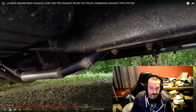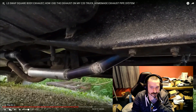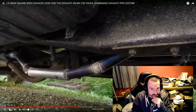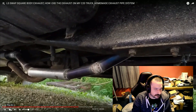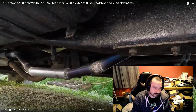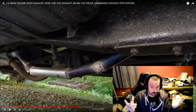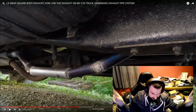I don't have a pipe bender at this location, and moving a rollback is not practical. When you don't have a pipe bender on hand, you are the pipe bender. Basically what we did is we cut a slice here, then we bent the pipe to get a gap, and then we just plated the gap. My plan is to get a pipe bender, redo this exhaust, undo this, and have everything pre-bent the way I need it — then just have one big piece of pipe.